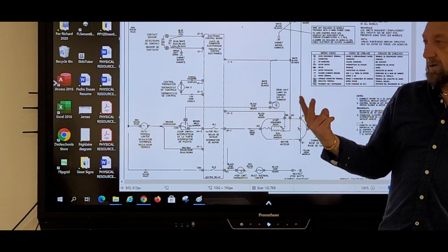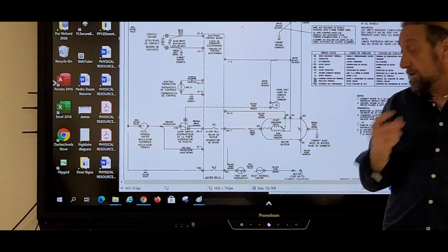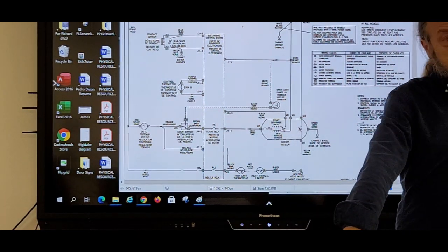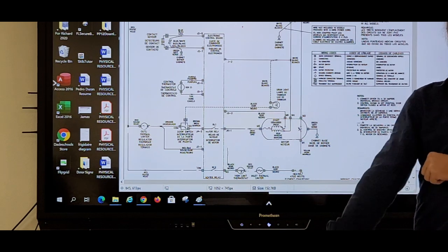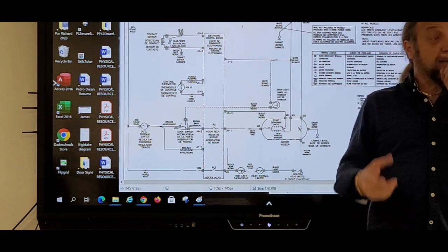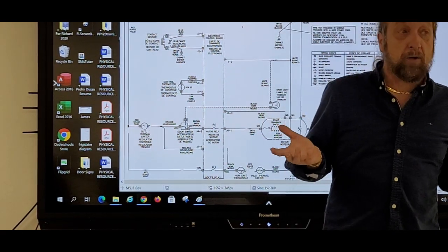So there's two ways you can test. Yeah, the wires are going up to the board from that. Can we put an amp probe around one of the wires and see if the heater's working? Amp probe, just like the pump? The clamp that goes around the wire. Yeah. And if I get amperage, what's it telling me? The heater's working, right? But what if I didn't have amperage? It doesn't tell me what's broken in the circuit.